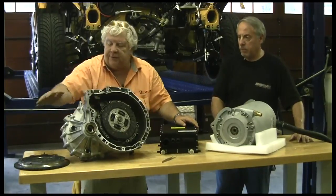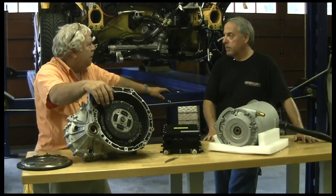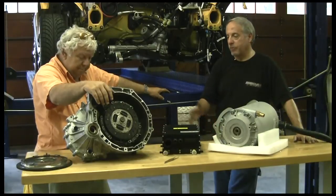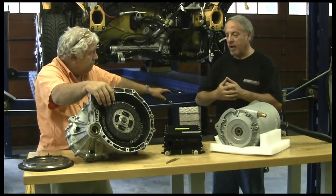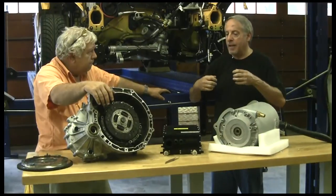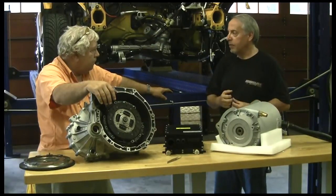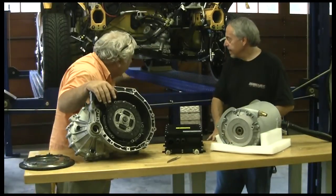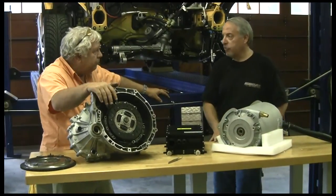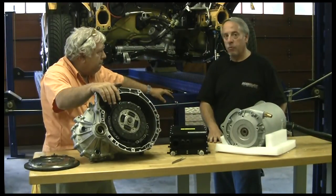Tell us about the modifications. We talked about a lighter flywheel. Tell me about this Quaife automatic biasing torque differential. What's that going to do for us? Well, the limited slip differential — normally in drive, the wheel that is lacking traction is really where it tries to put the power. With a limited slip differential, both of the wheels could slip a little bit. However, we're going to have drive much more smoothly applied to both of our front wheels under power conditions. The differential is integrated — it's internal to the transmission. So this transmission is going to be disassembled and reassembled with a Quaife limited slip differential.